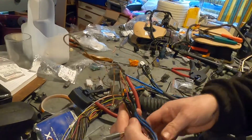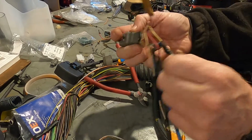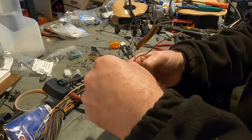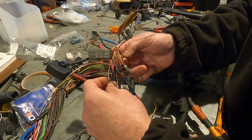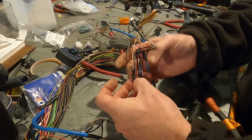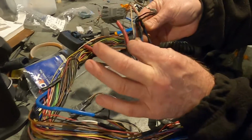And that's because in here we no longer have one shielded cable, because we're going to different places. We've got crank angle, cam angle, cam angle. There's the earth, which funnily enough, here's the earth here. So we've got the green as an earth and the white as an earth for the cam and cranks. They then come down to the same place down here, I've actually already taped that one up. But they join together anyway. The signal earths join in the front crank loom.